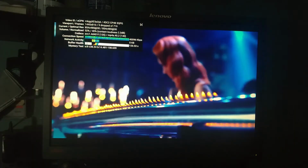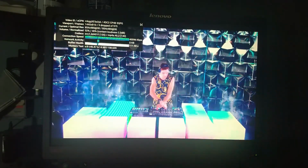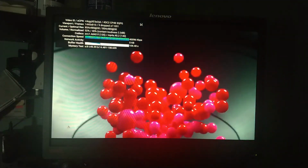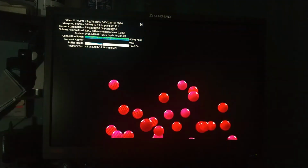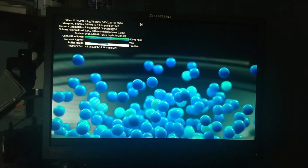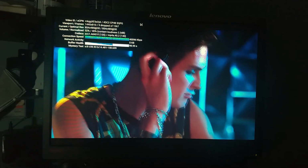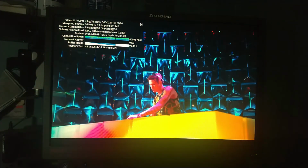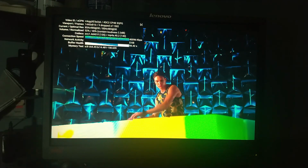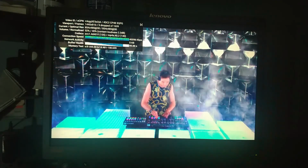Probably if we were in a Core 2 Duo, I think maybe the performance from a cache perspective might be better than what the Pentium has, but 480p is okay, and the rest of the system performance is going to be great. Business productivity stuff, Google Classroom type work, and word processing and all that stuff is going to work very well on this machine. And that's the whole point of rebuilding these machines, so they can go out to somebody who otherwise would have nothing to work off of except for like a crappy iPhone or a tablet or something.